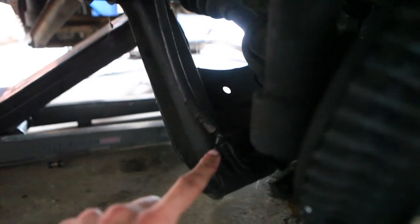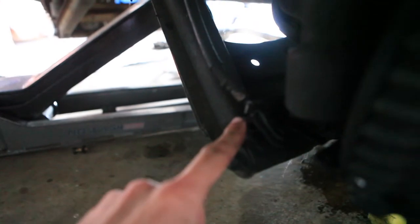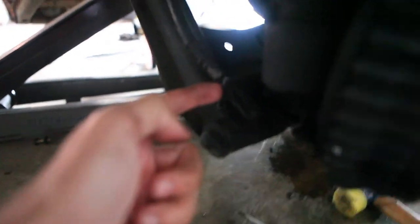Okay, so we have most of it dropped down. Both of the springs are unhooked. These main supports, I know it's really dark, these main supports under the differential are unhooked. The cross member is unbolted. And the last thing that we're stuck with is this e-brake line. And normally I would just hack it off, but I actually need this piece to work. And we have the C-clips off of it, which were right here, but now the spring is so compressed that I can't get it through here, so we're gonna do some cutting.